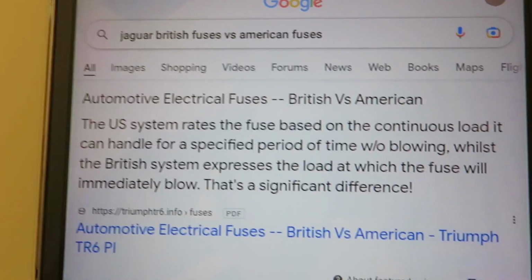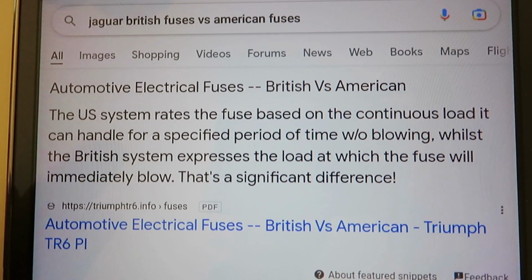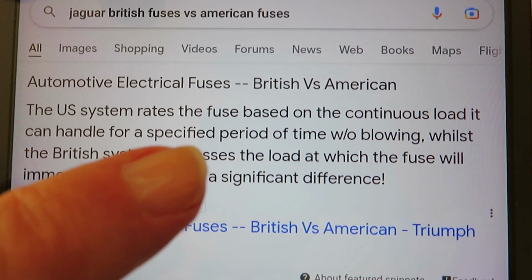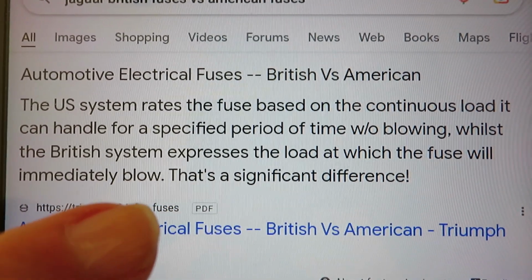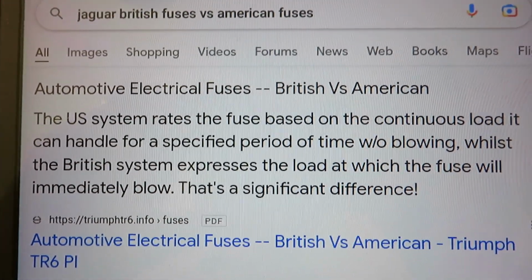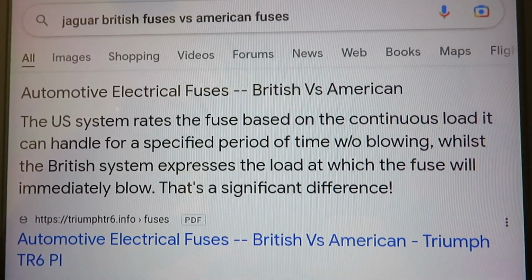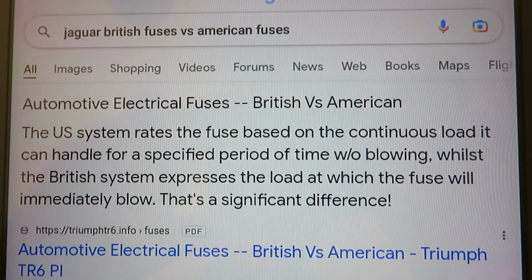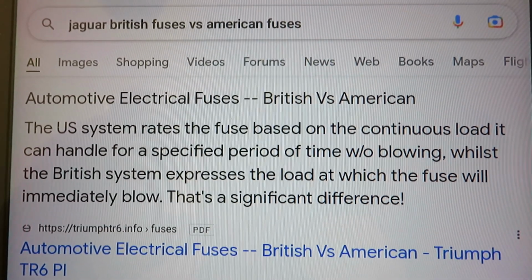I want to show you this. The automotive fuses, British and American, are different. The US system rates the fuse based on the continuous load it can handle for a specified period of time without blowing, while the British system expresses the load at which the fuse will immediately blow. That's a big difference. So an American fuse will take a whole lot more power, which means you have a higher risk of burning up your circuit. So you want to be sure and do the conversion. I'll put a link in the description that has a chart to help you determine which fuse you need.